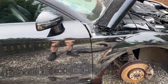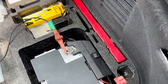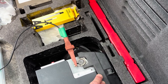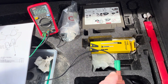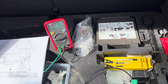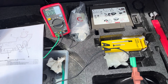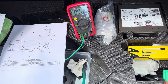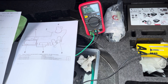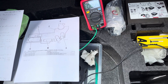Going back to the process: I took the cover off and isolated all the different feeds from the supply bar underneath, then connected my ammeter. One by one I reconnected them and monitored the current to see where it was going. Unfortunately it wasn't clear-cut, because the problem current was going on both feeds here, and looking at the wiring diagram both have pathways into the BCM — the body control module — which powers and controls many features in the car. That's where I thought my problem was for a while.